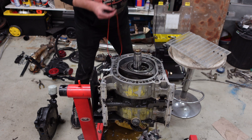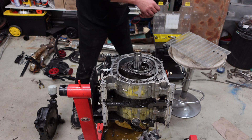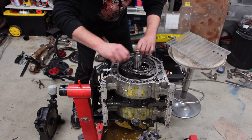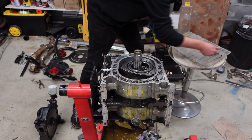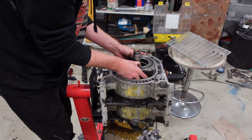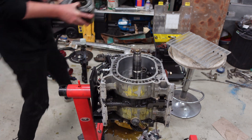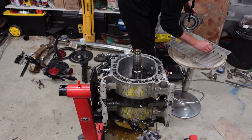These water seals are still all fine as well. These are cheap enough — you can get them from me or from Mr. Parts — so I don't need to reuse this stuff, but they're looking brand new, so I can if I want to. I'm going to take these seals out. I'm going to try and not lose the apex seals, but we probably will. All right, I didn't — that's a good feat.